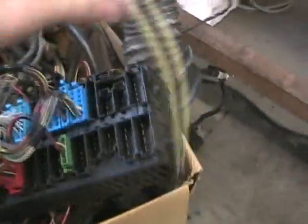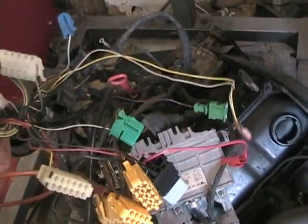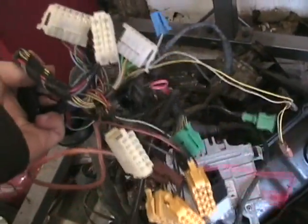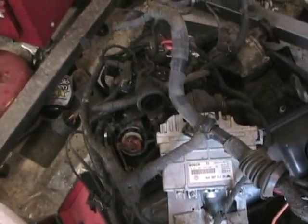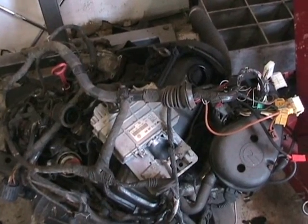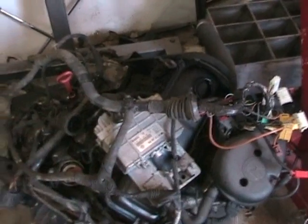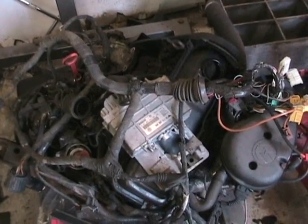I've got a whole system here out of a 96 Golf, and you can see to get it out I didn't have to cut anything — I just unplugged the engine harness. Same connector. Turn it over and you can see that's your same everything. Here is the other end of that, and here's the boot where it went through the firewall. This is all of the engine plugs and the front lighting plugs — they integrated those two harnesses together on this car. But it was so easy to remove; I just unplugged it and pulled it through the dashboard. The computer connector is on all that same harness. So if you wanted to take this engine and put it into a different car that didn't originally have it, you would just unplug the engine harness from that car, bolt in the engine, put in the wire harness, install the computer, and then install the appropriate relays in that central electric block. And that would be it — it would work.